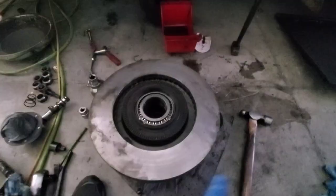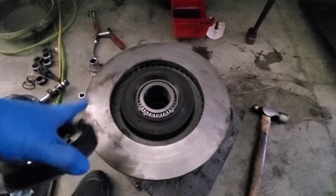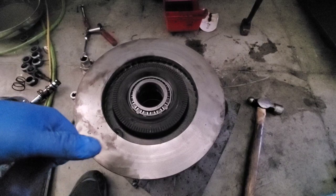So the rotor is on and tightened down. Now I'm not going to give you guys any torque specs on this because you're going to want to consult your manual. Just like when we go to do the bearings — I'm going to go ahead and get those set, but again you're going to want to consult whoever made your axle, because these numbers will change based off of the manufacturer of the axle. So get the new seal installed in it here.